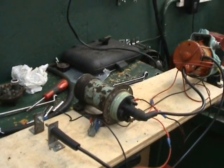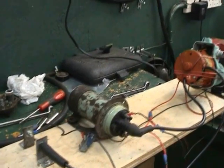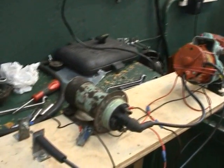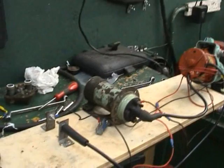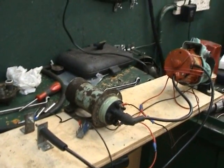We are in the workshop today, and today we're going to do an Electronic Ignition Masterclass. As you can see on the bench here, we've rigged ourselves a small device, because these Champ chappies have these horrible point things. We're trying to eliminate all those, because they tend to wear, and you have to keep changing the points, and doing the gap, and all the other things that really, really annoy you.